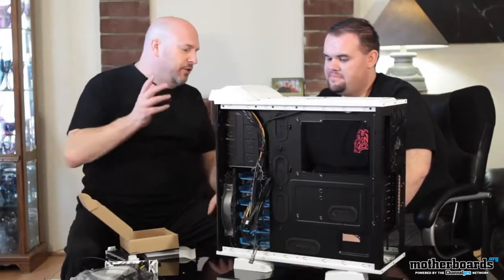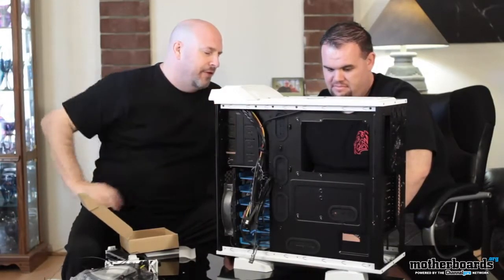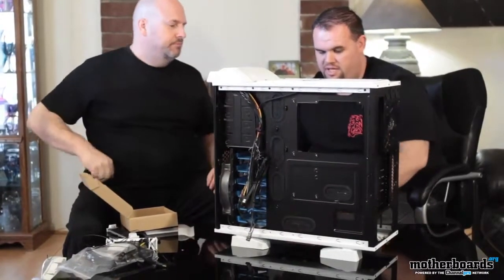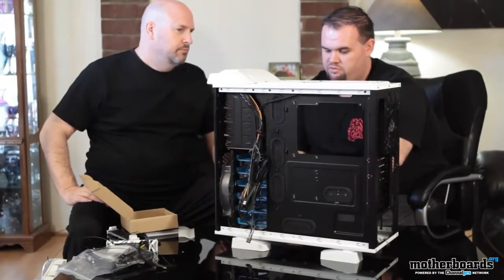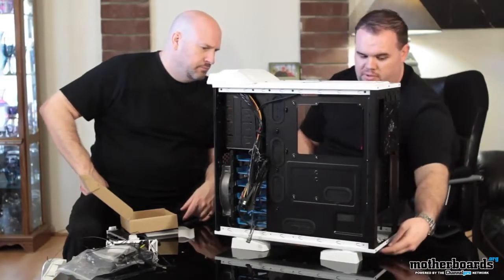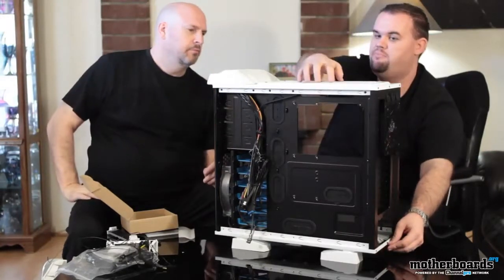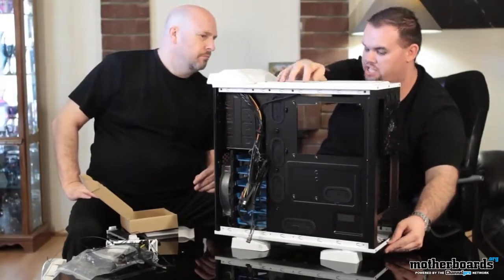Shannon, thanks for coming in, but I did notice that there is something else that we did not talk about, and that is the very bottom of the case. Let's not miss that, because there are some features about the very bottom of this case, so let's talk about them. Well, yeah, you have the option to fit fans at the bottom as well, for instance a 120 millimeter fan directly at the bottom that can blow up or down, whichever you prefer. But one important feature also is, like I said before, the integration of fan filters. You have the front one I showed you. The top one has it integrated as well. It's not really removable. It's more just keeping stuff from falling into the chassis.